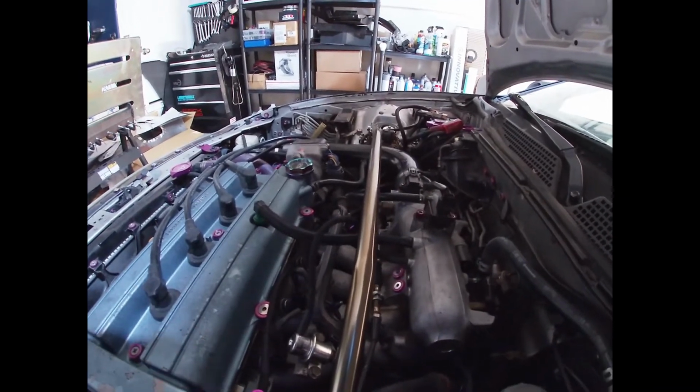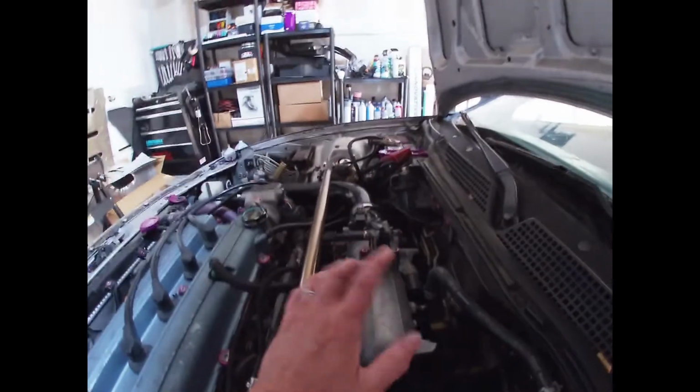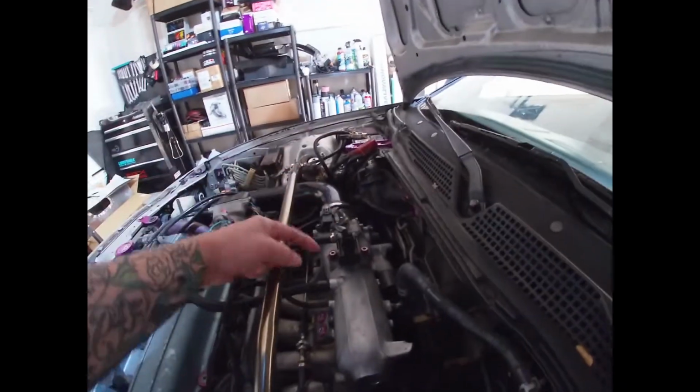I was just wondering how bad was it in there? So I took the borescope, stuck it in through the throttle body to check in there. She was dirty. She was dirty. It smelled like so much fuel was in there. I just took a little wipe, sniffed. That was nasty. It was just pure gasoline smell in there. So that diaphragm has been going for a while because that thing was just caked and just gunk. But it should be clean now.